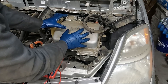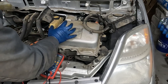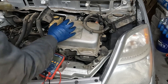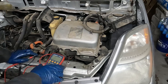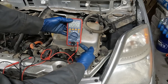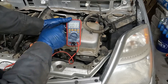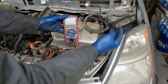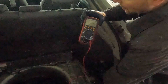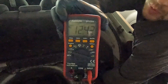Next we're going to tackle our inverter. Normally when the service plug is disconnected there's no more voltage coming up front — it's no longer a live circuit — but if there's any kind of malfunction we could be exposed to high voltage. To double check that everything's dead we're going to be using a volt meter. We want volts DC, red in the input, black in the com. We'll go back to the regular 12 volt battery and double check that this is working. I'm hooked up to the 12 volt battery and you can see we have 12 volts, so we know our meter is working.